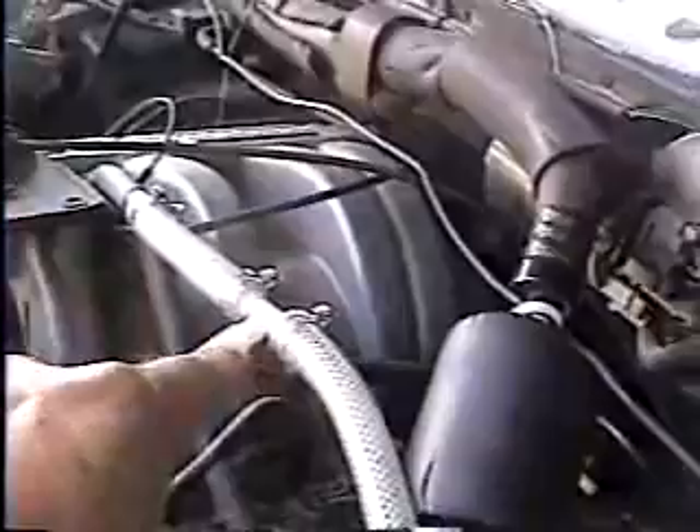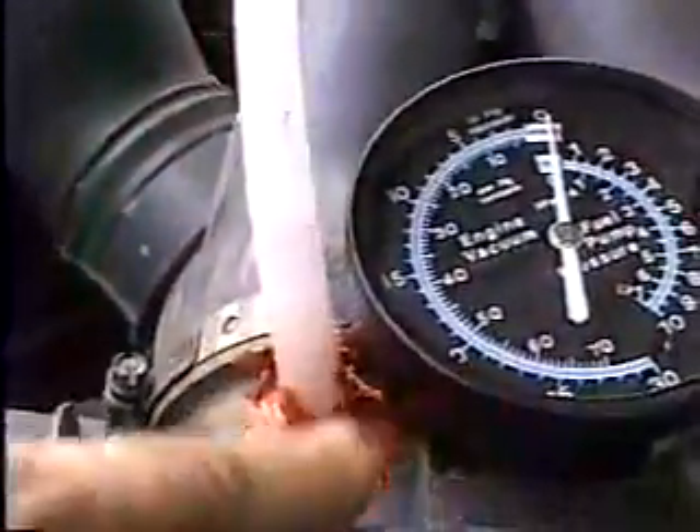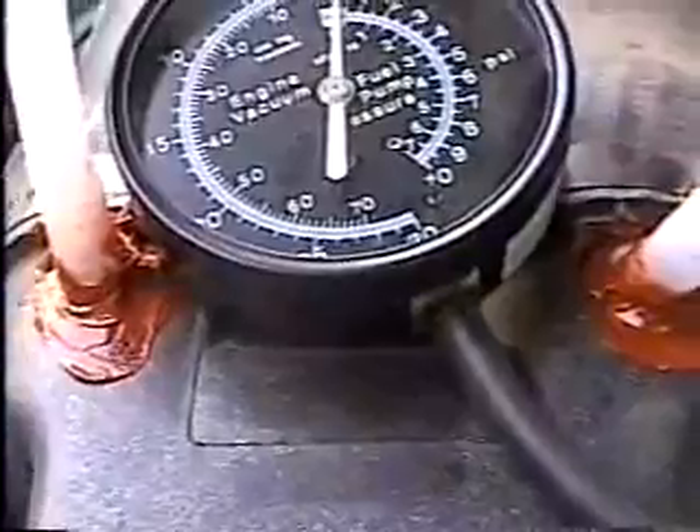What I've done is made a T-joint right here, brought that T-joint down with a gas-liquid valve and teed it, then brought both ends around — one to here and another one over there — because there are two tubes on a Ford that go into the intake plenum. I have one here and one there, each drawing by Venturi action. When accelerating, instead of vacuum dropping off toward the engine and using more gasoline, a vacuum is created here, splits to the two pipes, and comes down into the air intake plenum box from the air filter.